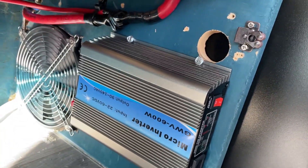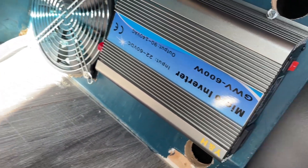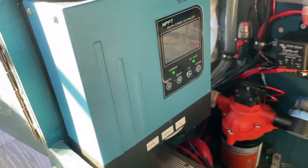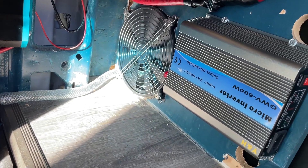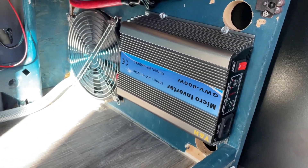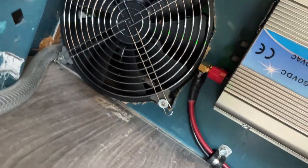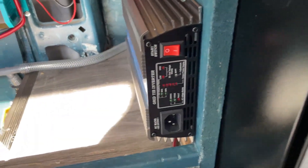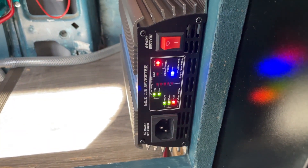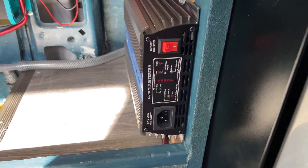Next is to wire it — just the two solar inputs on the back. I'm going to pull off of my main solar inputs going into the MPPT solar charger. Then that should be it for wiring, besides the 120-volt output. The grid tie inverter is now tied into my solar — the same solar being used by the van to charge the house batteries — and it looks like it's got power. Next thing to do is try plugging it in and see what happens.